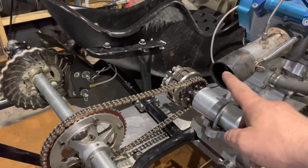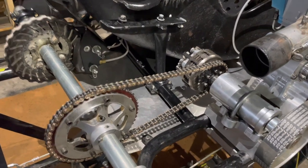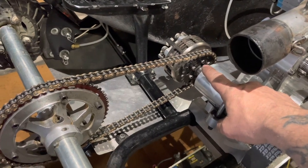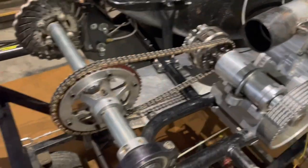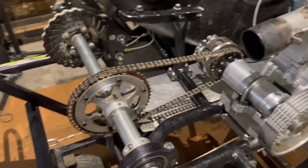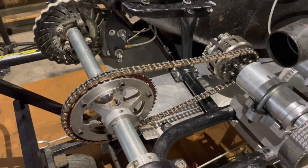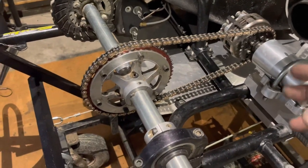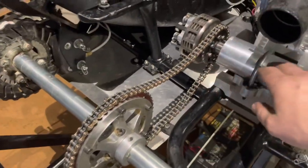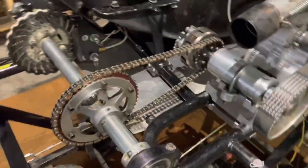I have my pipe off - my pipe would be coming out here and you can't see anything when it's on there. If you're curious what gear that is, that mammoth gear is a 26 driver with a 54 rear - going to a big track so you need that ratio to work out. I put a brand new chain on this; the other one was a little short. What I missed was the tensioning. The motor is loose here, so I get the chain over top and push it forward until there's some tension.